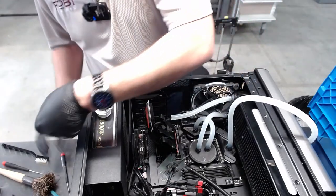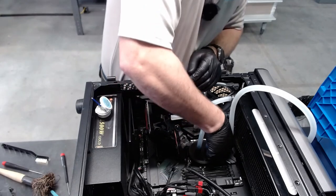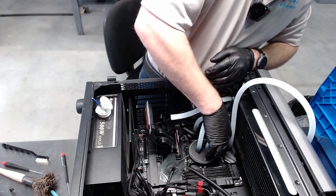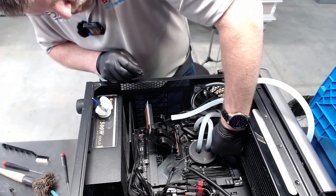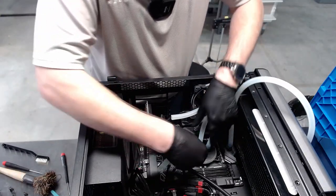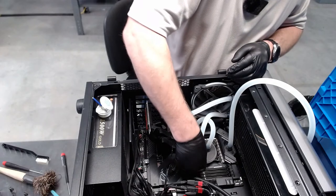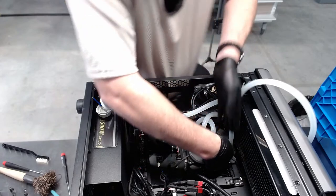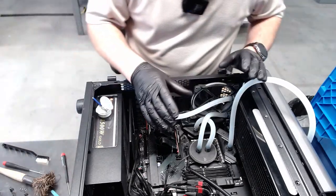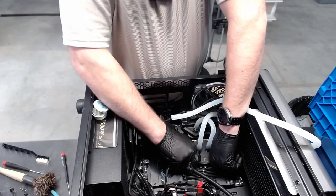Okay. Guys, I think that's all she wrote for fasteners. Okay. Disconnect the LEDs. This is the most nerve-wracking thing about all these pin grid arrays, the PGAs, is when you lift it out and try and break the seal to the heatsink, is if it pulls the processor up too and you bend the pins. Such a nerve-wracking part of this process.